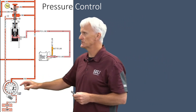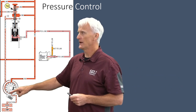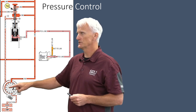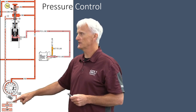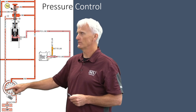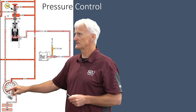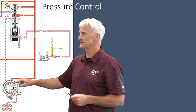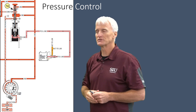Actuator feed limit pressure is important, but so is line pressure. The way we generate line pressure in this transmission is with this variable output pump assembly. It rotates the center section called a rotor — clockwise as drawn here — which allows fluid to be sucked in from the pan through the filter and into this pump cavity. As it rotates, we get an expanding area that creates suction, then it squeezes off and compresses the fluid, pressurizes it, and pushes it through the line pressure circuits.